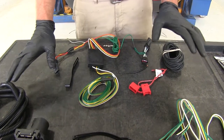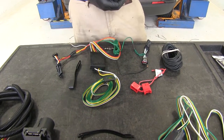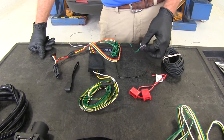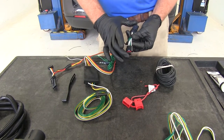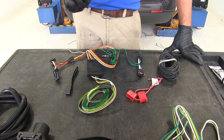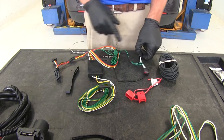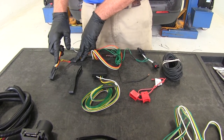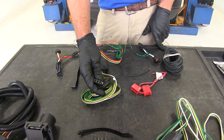This is a little bit different kit than our first two. The first two we're going to plug in, place in our fuses, place in our relay, and it's going to work. As for our Curt T-Connector kit, you'll have to ensure that you don't have rear air conditioning — if you do, you can't get to the plug on the passenger side where you need to plug this T-Connector in. What this does is it plugs directly in line between the factory wiring and the factory tail light housing. That allows the box to receive the signal from the light and activates whatever light we need. We pick up the turn and brake from the passenger side, and on the driver's side we get our turn, brake, running lights, and stop signal — all sent into that box, which then sends it out as a usable signal for our trailer.